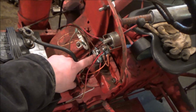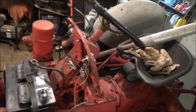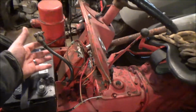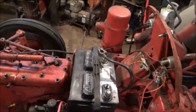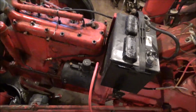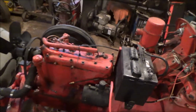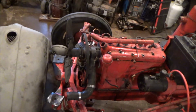It's got the one wire 12 volt alternator, which is good. 12 volt battery, obviously. I'm going to switch to negative ground, from what I understand. You know, this is the ground, and it goes to the body or the frame or whatever. This is on the hot side of the starter. So I think everything's pretty much good, other than maybe eliminating this, and then buy a 12 volt coil, which isn't that bad, $40, $45 or whatever.